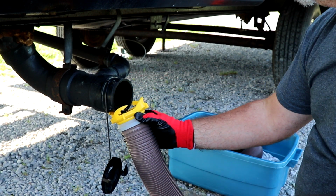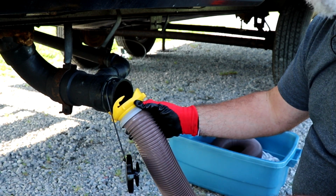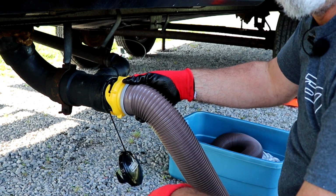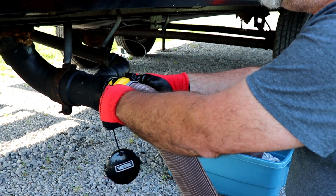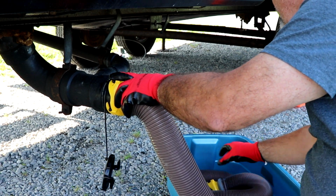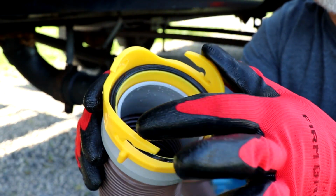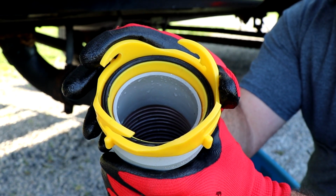So what we have here is several clips, or nibs, on your actual drain itself, and your sewer hose simply comes up, you place it flat on, and then you turn it. Now, the cheaper hoses will typically only have two of these arms, and I'll bring one over closer to you so you can see. Typically you would only have two of these arms, one on each side to hold it on. When you buy a better clip, you're going to notice there are 4 of them.